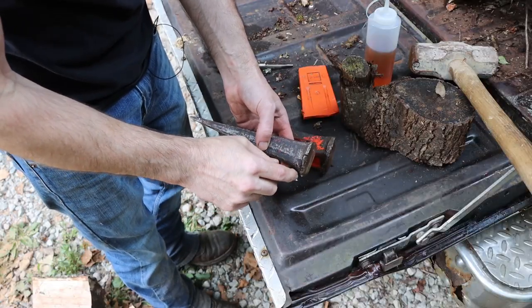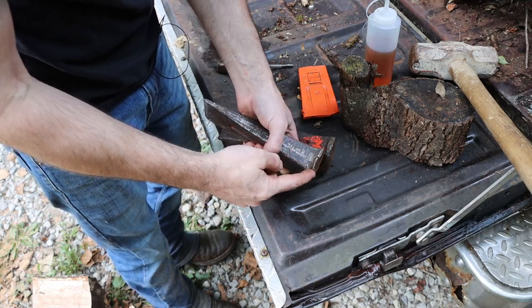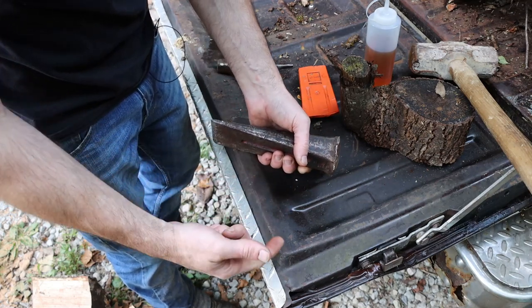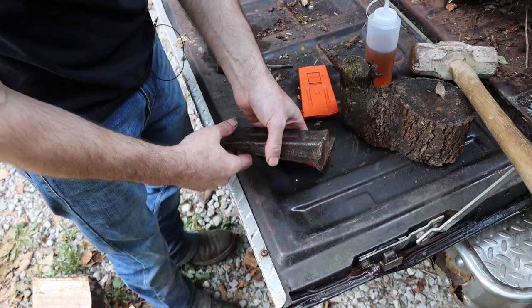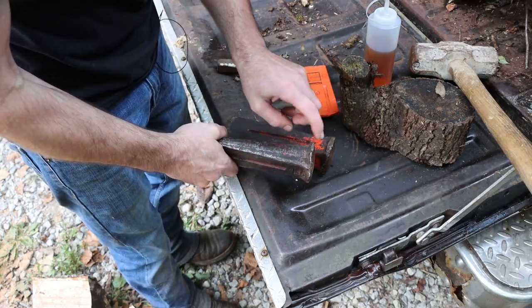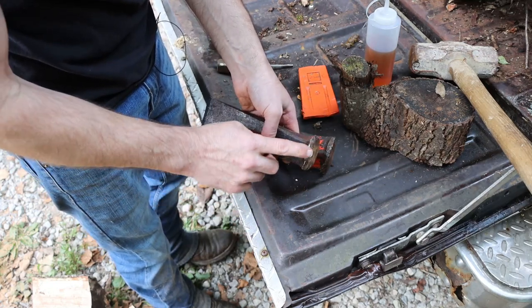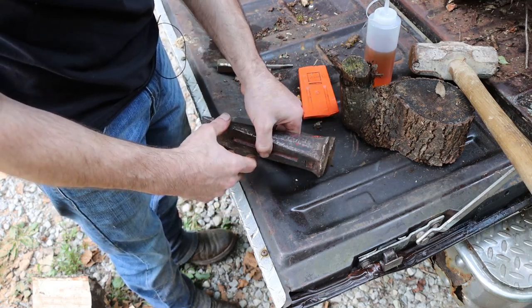I know I'm not the only one who has enjoyed a big sliver of metal shoot off one of the tops of these mushroomed tools and drive under my skin. I had a piece almost the size of a pea shoot into my arm. It was amazingly painful and not something you would expect unless somebody told you about it. But yeah, these mushroomed heads really need removed. People have talked about it in the past, but on any tool like a chisel or anything, not a good idea when they get mushroomed out like that.